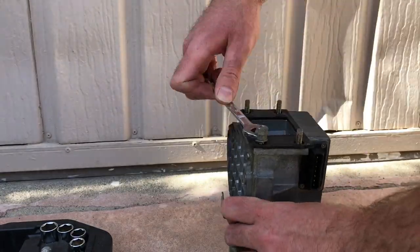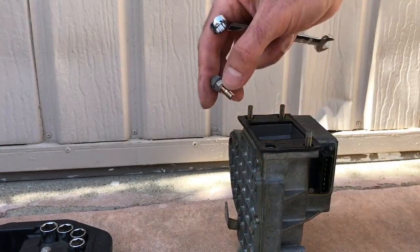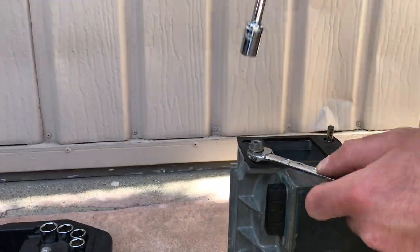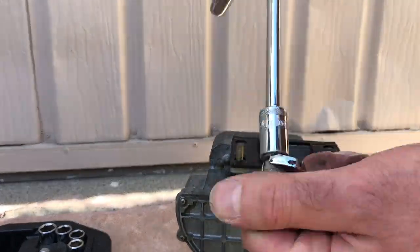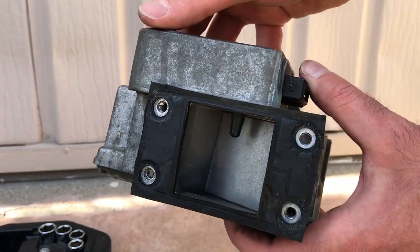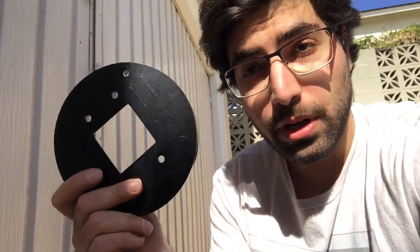It's a really cool trick, and as long as you can thread two nuts onto the stud you don't need to buy one of those special stud extractor tools. The next step is to take the little adapter bracket included with the kit and put it onto the mass airflow sensor after you've got the studs removed. We're going to be reusing the stock gasket as instructed — mine is in great condition, so that's not a problem.